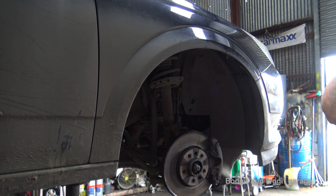You can hear all the rust coming off that. And there we go — you can see that saves all the hassle of drilling it. The shock does the trick. It was just rusty, and if we had done that after taking off the caliper and everything it just would have been a lot harder to actually wedge the disc, so that's why we do it now. Take off the retaining spring.